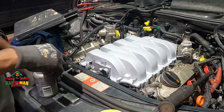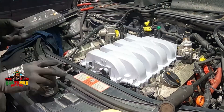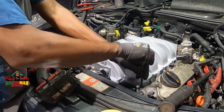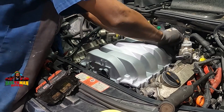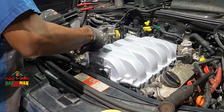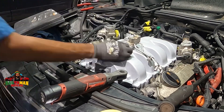Now I'm going to get the bolts. I use a little anti-seize — it's my insurance. You don't have to do it that way, but I do it like that. You never know when something will tighten up on you and break off and extend the whole install procedure. I just run them down preliminarily by hand and then a little bit more with my Milwaukee electric ratchet.